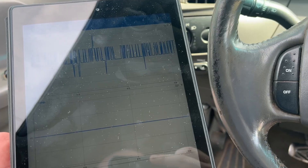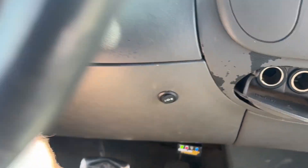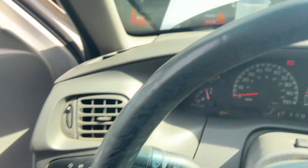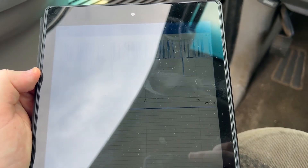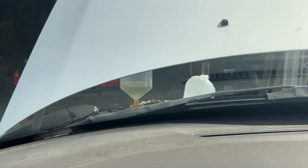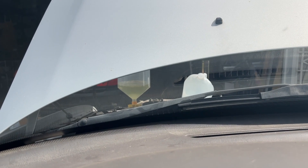Link is down below if you're interested. We're well past operating temperature and the fan never kicked on. I went ahead and just flipped the switch to force it to on, so one of them is running right now. The other one is off because the AC is switched off. It's filled the funnel up and it's still bubbling. But this is worse than we were last time, so there must be air in the cooling system still. With how much trouble I'm having with this heating and cooling system, I've wondered for a while — am I getting erroneous readings from one of the sensors? Every sensor is brand new, OEM Motorcraft. Still at 220°F. I've tried two different thermostats, swapped every part you can think of. Everything is brand new OEM. I guess I'll stay patient because it's still bubbling up — maybe there'll be some life left once all the air bleeds out. But I'm not convinced, honestly.